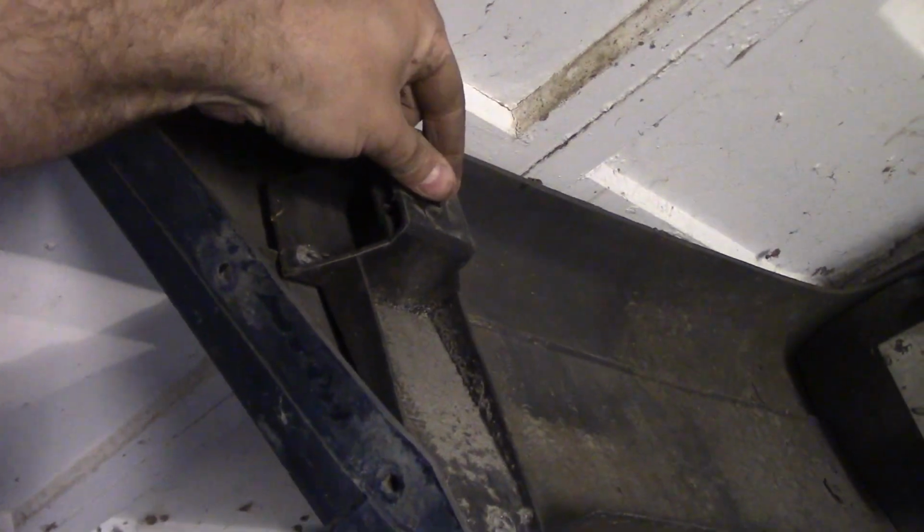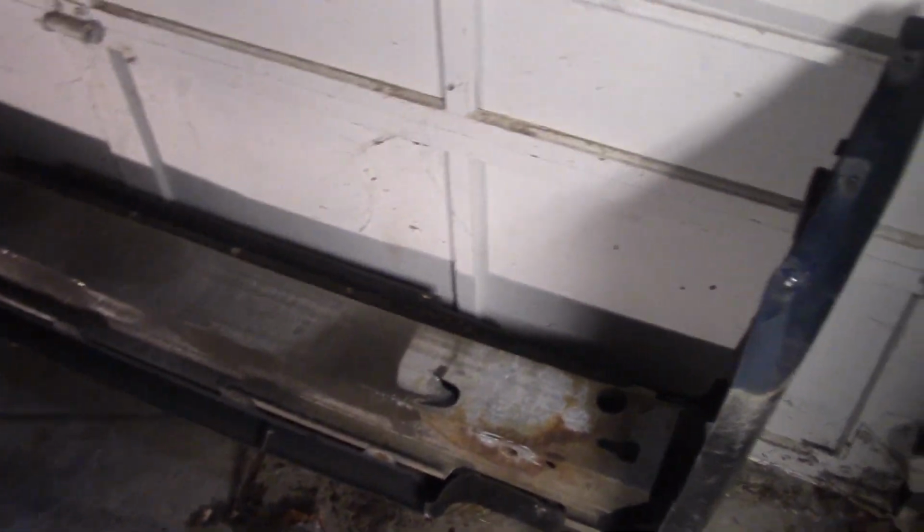But yeah, these are the slides that go in here. I didn't mention those before. Should be another one right here. Yep. The other slide. So just gonna leave those there for now. Don't lose those. If you don't take the nut out all the way, you should be able to just pop the bumper right out. So that's that, and I will see you in the next one.